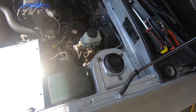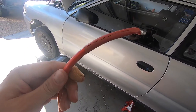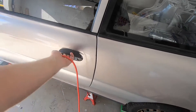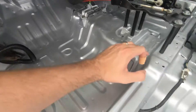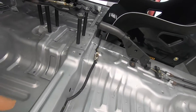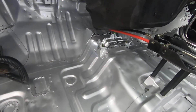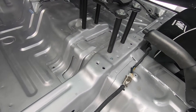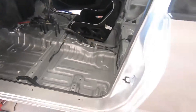When it's time to start this thing, this will then provide the juice for that. Once it cools off a bit we'll thread it through. Down below I'm going to run the cable from that hole there, down along here, and then back up and down the back — just one straight line. I'll run it underneath that bracket there just to keep it somewhat sturdy. I've already put a rivnut in there just to test the hole — I'll just put a clip to keep it steady. Then do that along down the back.